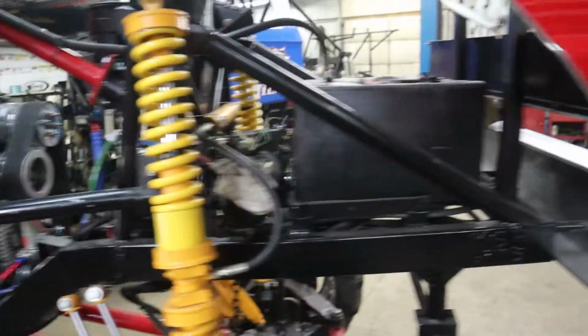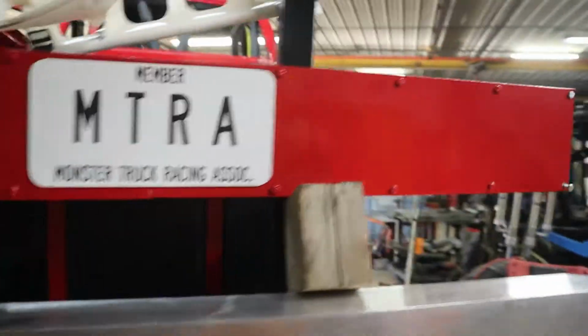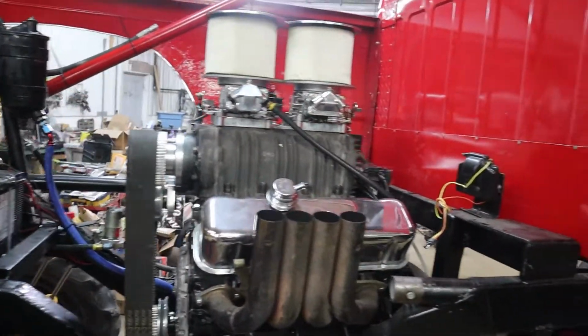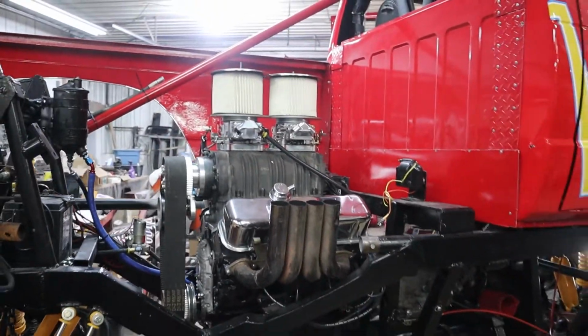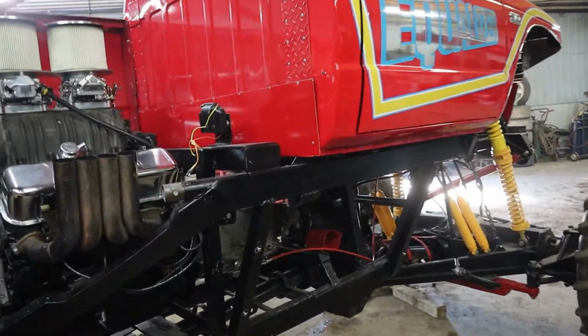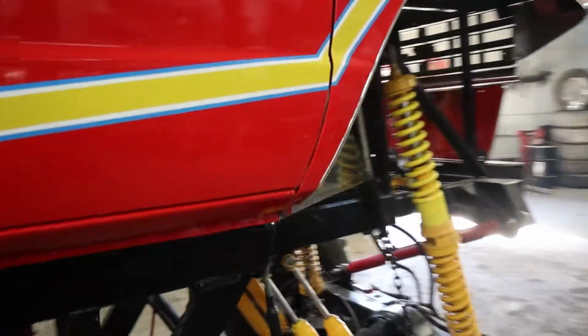Blower belts on. Sean, my cousin, came over and helped me get the carb idle adjusted. The back flaps in the carb were actually bent. We pulled them out, smashed them flat. Got the idle set to where it's a little bit better now. So yeah, a lot of work been done on this thing in a little bit of time.